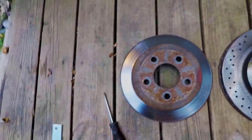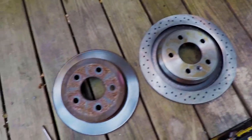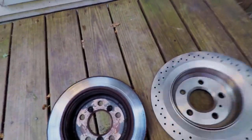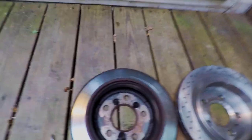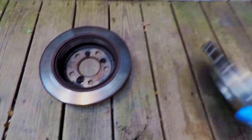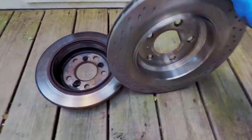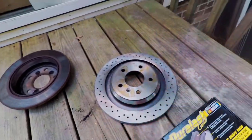It's worth pointing out the differences in these rotors. It doesn't take much to see that they are way different in size. The internal parking brake shoe portion is supposed to be the same and feels like it probably is, but that is where the similarities end. The stock unit is a solid, non-vented disc. The GXP rotor is a much wider, vented disc that's also cross-drilled. Interestingly, the opening to the fins is on the outside of the rotor and the back is actually solid — very different, but should be a big upgrade.